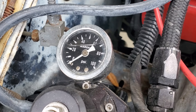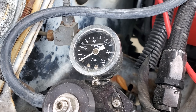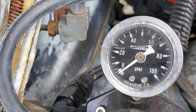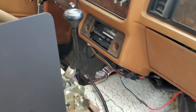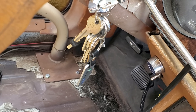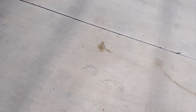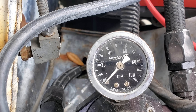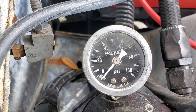Theoretically, the fuel pressure should rise with boost. So how do you set up your fuel system? This is what we tell people: key on, engine off, we like it to be at 55 PSI. So let me key on and show you what it reads — just walk over, flip the switch, and you'll hear the fuel pump activate.